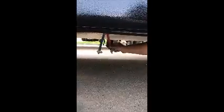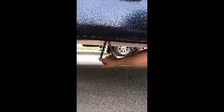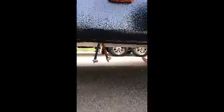You've got speakers outside for your stereo. You've got a night light out here, your awning. So down under here, you've got 2 low point drains. This will drain, this is the hot side, this will drain all your water lines inside, and this is your cold side. So turn these valves and all the water inside of your drains will drain right out these 2.